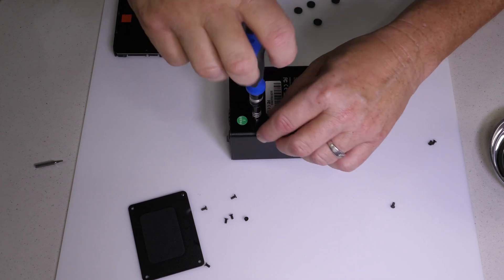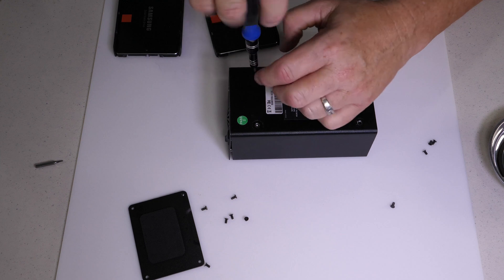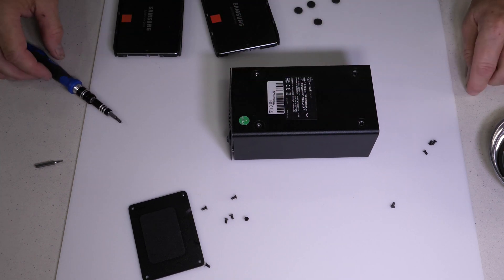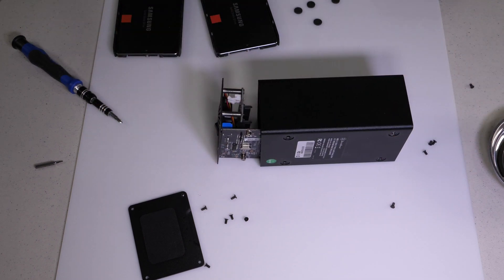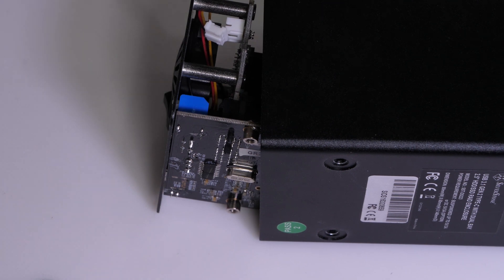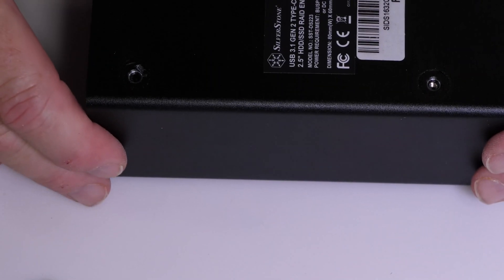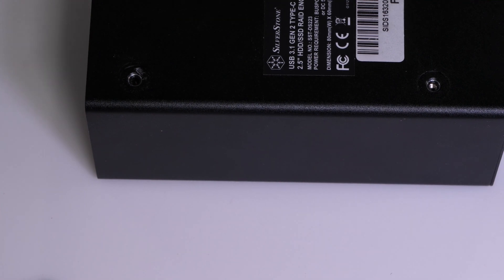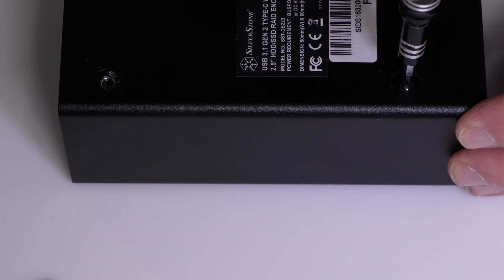Let's take this apart. What you're going to see is this whole assembly just slides out. As you can see right here — let me zoom in on that a little bit — I've actually pulled out the fan header. There's a fan header right there, and I've just popped that out. That's pretty much all there is to it. It's not very difficult; you just have to be careful. Do this at your own risk and see how important or how loud that fan is for you. For me, I found it to be not acceptable for what I was doing, so I chose to remove it.